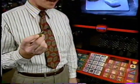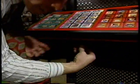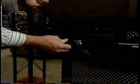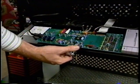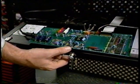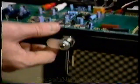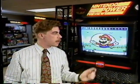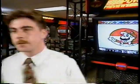To do that, you take your key number 2007, go underneath the keypad, and open up the keypad, and then drop down the front door. You'll find two different buttons here. One of them adjusts the attract mode volume, while the other one will adjust the volume of the game that you just selected. You may also see another version of this that's 30 inches wide. Now, we've got a lot more to look at, so let's go take a look at those.